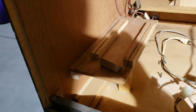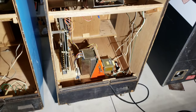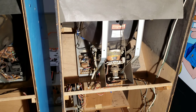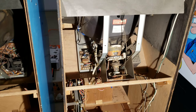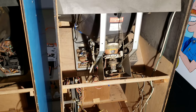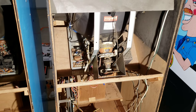Going to get that piece glued back on, a few more cleaning items in here. Got some of the cables washed - they were pretty grody. Got it all hooked back up, everything's working, so we're good there. I'm going to move on to the monitor next, after I get the control panel reassembled. We'll get the monitor stuff cleaned up and we're going to give this one a cap kit. It has a slight hum, so we're going to cap the audio board as well.